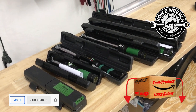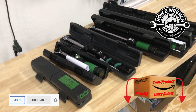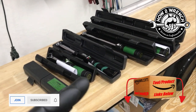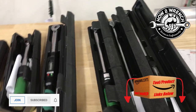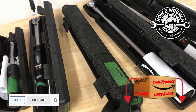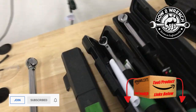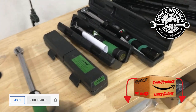What I've been doing is grabbing my Snap-on and Craftsman wrenches and using them in comparison — are they clicking at the same point? It's not a calibrated scientific test, but when you've been turning wrenches a long time you can quickly identify what feels right or wrong. So we have a 20-to-100 foot-pound wrench, which is the one I want for my axle at 32 foot-pounds.